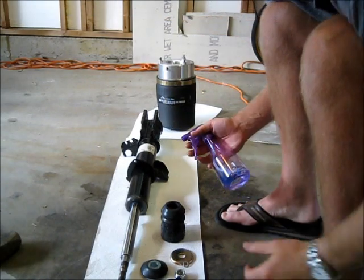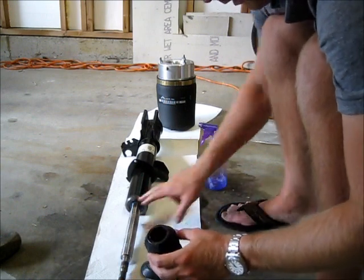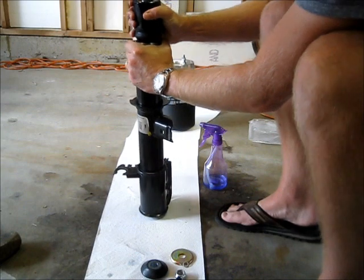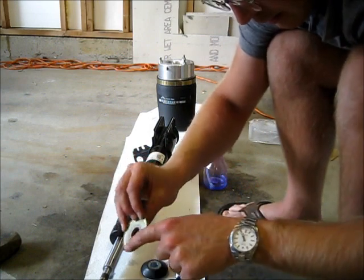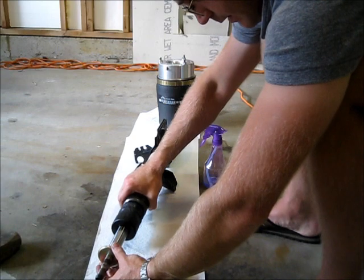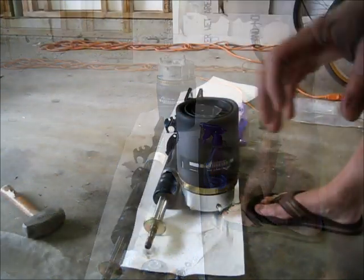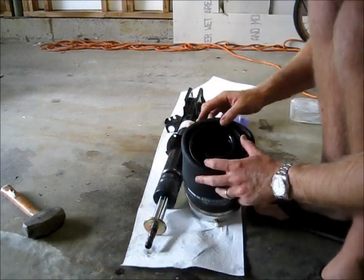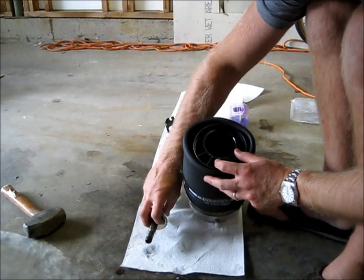We'll start to put it all together. Starting with the bump stop — I'm going to spray a bit of silicone-based lube diluted with water — and slide it all the way down the shaft. Next we have the gold washer, which has two sides: a cup side with a lip, and that lip faces down. That's extremely important. Then we're going to put on the actual air spring. I'm going to slide this down through the shaft, lining the locking pin up with the hole for the locking pin on the bottom plate of the strut. The gold washer is in place, lip facing downwards, flat surface on top.